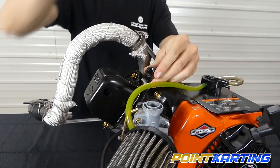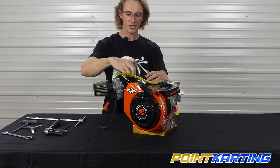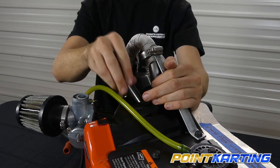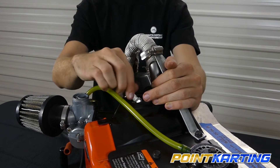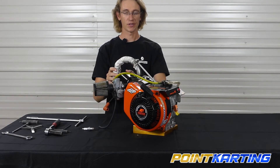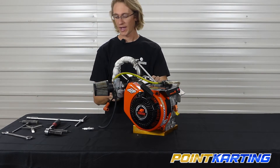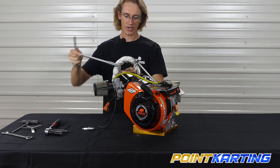Remove your socket and turn the rest by hand. As you remove your spark plug, try to note any resistance or binding on the threads, as this could indicate worn threads. Once the spark plug is off, the next step is to remove the rocker cover — some people call it a valve cover. Either way, there are four 10mm hex head bolts, and you'll need an extension and a 10mm socket to pull that off.